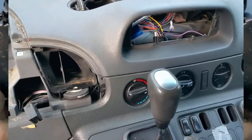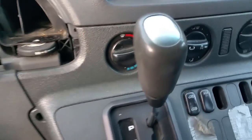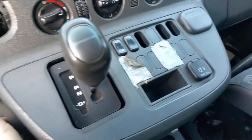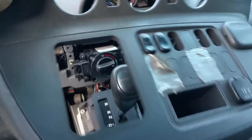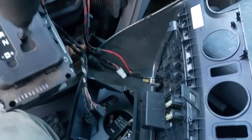This is how you disconnect the ashtray. For removing this center console section it's tricky because you'll actually have to shift the shifter — or I could just use a screwdriver. Put that in and shift it to neutral. It doesn't have to be neutral, but it's just enough so you can pull these pieces out with nothing in the way. Then just pull on the dash from the bottom and out like this. Once you have all the bolts loose, you just pull it out like this and remove those connectors.